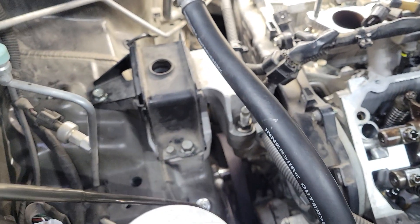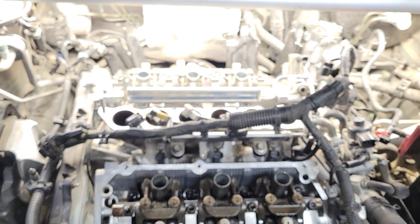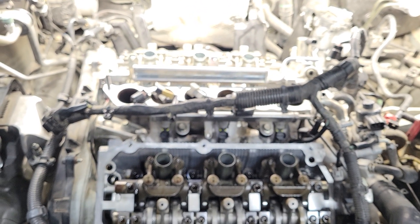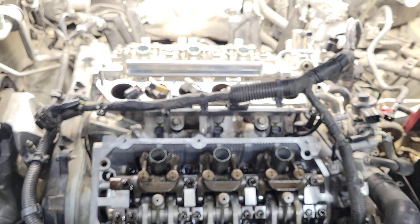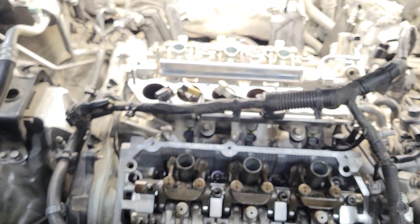It's a 22 millimeter on the crank pulley. Assuming your car hasn't had any jumped timing, everything's in time and this will work. But if you have to redo your timing job, do that first before doing this.